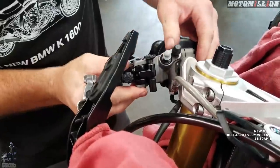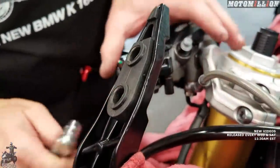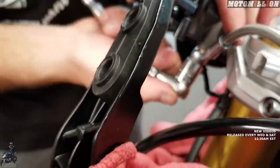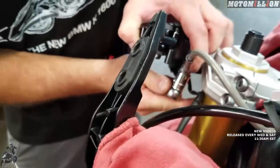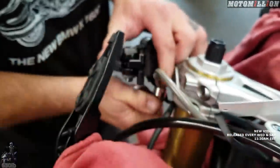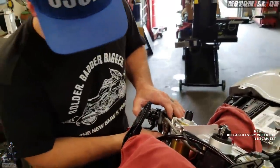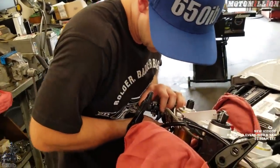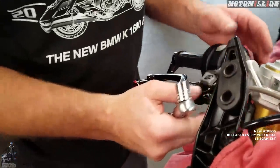We snug it just so you feel the crush washers start to crush. At this angle though, that brake line is hitting on the fork, so we need to move it. Good catch — some mechanics don't bother with that and leave the customer to deal with scrapes or a high brake lever. It's all about routing and taking your time. Sometimes it takes way longer than it should but it's always worth it.